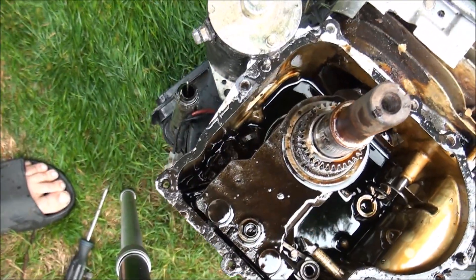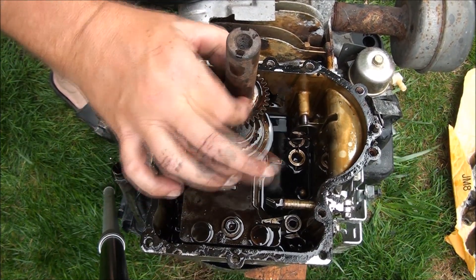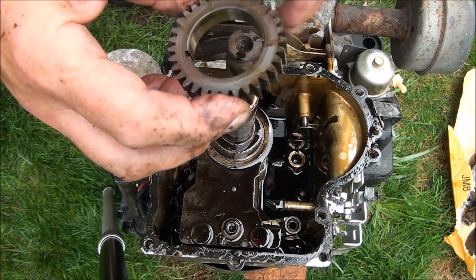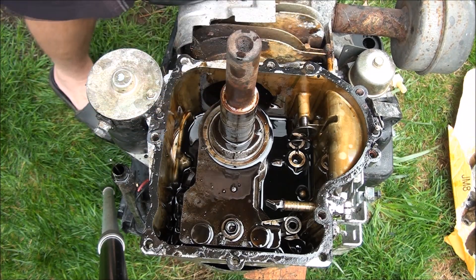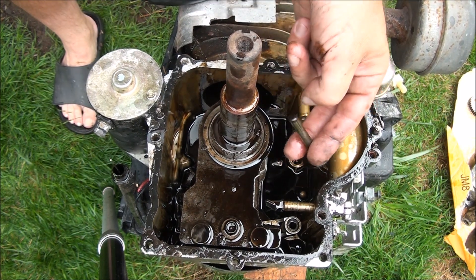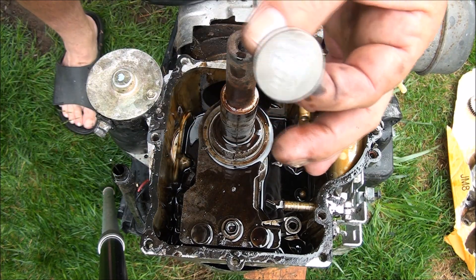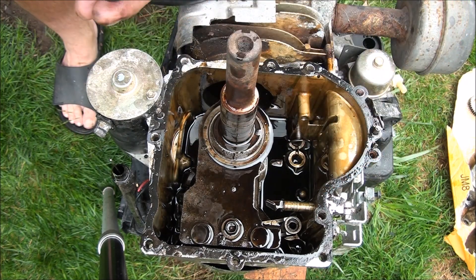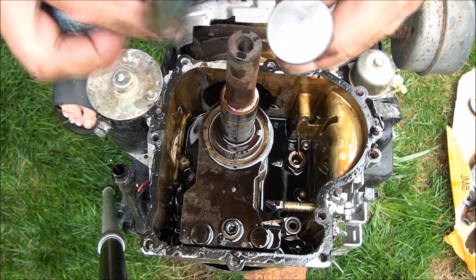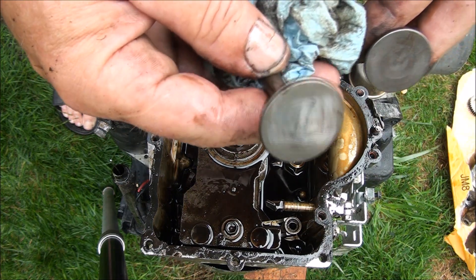Check that out — that's a whole pile of metal. This is your timing gear, which just slides right off. Doesn't look like it really took any damage. And these are your tappets, or your lifters — whatever you want to call them. You can see they've taken a beating where they mesh with the cam. Pull this other one out — yeah, that side's not as bad. Looks like the exhaust side got a little more worn.